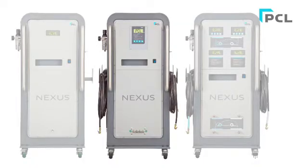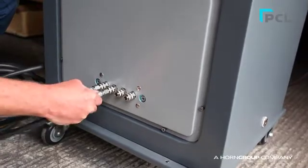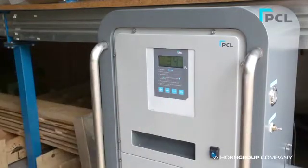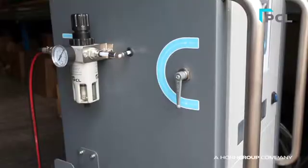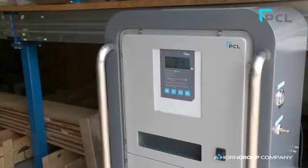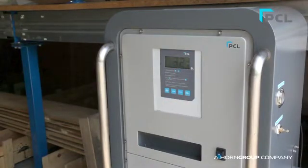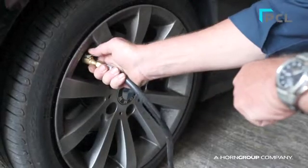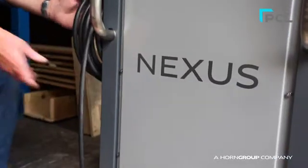For the generator and built-in inflator unit, simply connect the four hoses supplied to the four output connections on the bottom of the unit. Set the target pressure using the plus and minus keys, then clip the connectors to the tyre valves. Turn the stop-fill valve on the side of the unit to the fill position. If you only want to top up a tyre already inflated with nitrogen, press the start button on the front display. If you want to convert an air-filled tyre to nitrogen by purging the tyre, simply press N2 on the front display screen. Once the unit has completed inflation, 'end' will be displayed and an audible beep will sound. Turn the stop-fill valve to the stop position and remove hoses from the tyre valves, storing them on the hanging brackets on the side of the unit.